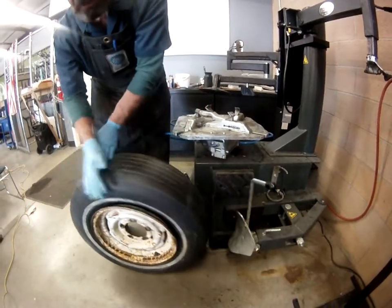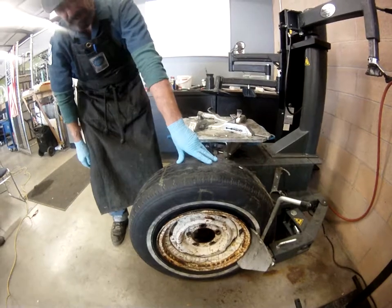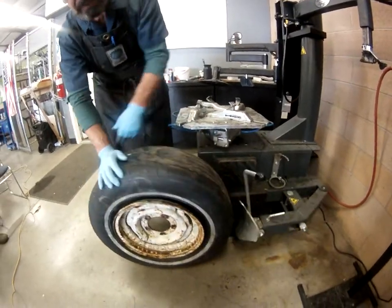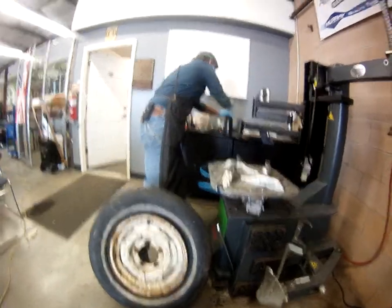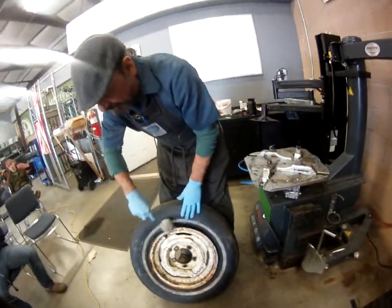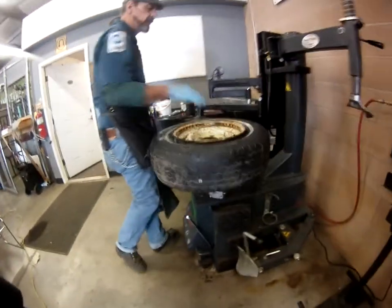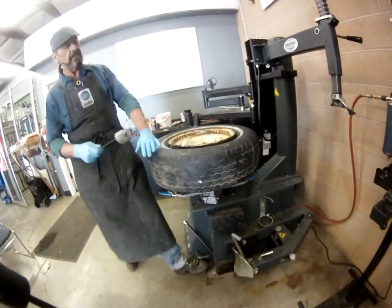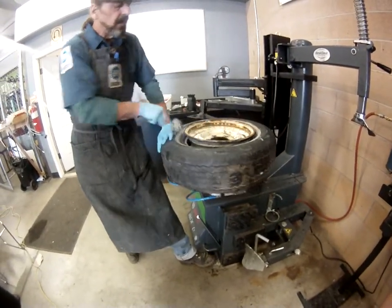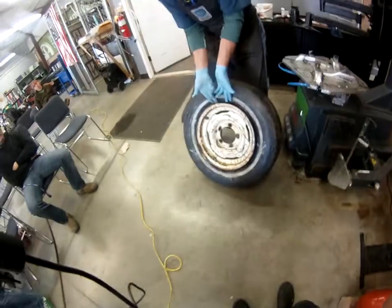Keep in mind, this tire has been broken so many times it wants to just jump off the rim. Most of the time you're going to have to break a tire in two or three different spots just to get it to let go. Generally, I'm going to lube up the tire so it doesn't stick. I don't want the tire to stick here if I break it on the other side. My brush is too big to get in here, so I'll just flip it up, drop it down, put it on the machine, and let the machine do all the work. This way I can get that bead lubricated and I don't have to worry about muscling the tire too bad. Let the machine do a lot of the work for you — now there's no chance for this tire to stick to the rim.